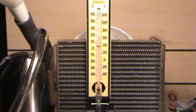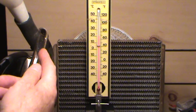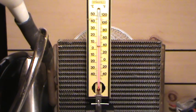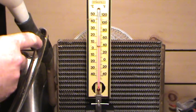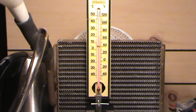For winter here in Canada, as long as I've got a 180°F thermostat in the vehicle that'll give you plenty of heat. When pollution-equipped vehicles came out in the early 70s, they went to a 195°F thermostat. We're going to put in over 200°F water. I've got a funnel going into a piece of heater hose and into one of the tubes, and an overflow tube going down into a bucket on the floor. As it fills up, I'll stop when I see overflow water going into the bucket.